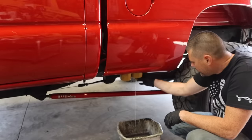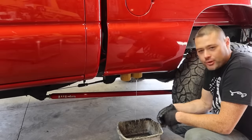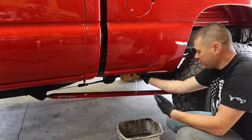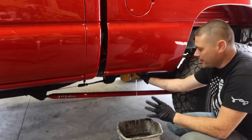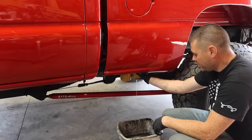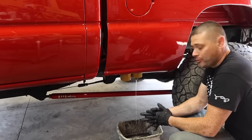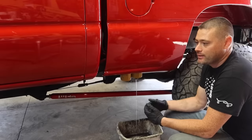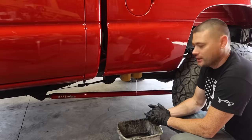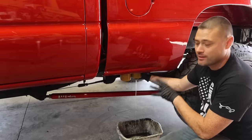You're going to see some water coming out — not a lot in this case because I replaced these not too long ago. It's always a good opportunity to open it up and drain out the water coming out of this filter. I am not using the FASS filters — I'm not a big fan of them; I did a video on why they're very problematic. I actually like the Caterpillar filters myself. My buddy Mark DeCola sells these on his website, MDD Performance. I'm thinking about eventually moving up to an AirDog 165 instead of the FASS 150 I'm using. Either way, lift pumps are always a great option for diesels — they separate the water, dirt, and air from the fuel, which really keeps those injectors lasting a lot longer, especially for the first-generation 6.6-liters — your '01s and '04 Duramaxes. I highly encourage you guys to invest in a lift pump for your diesel.